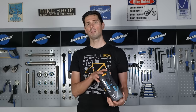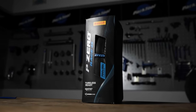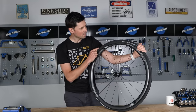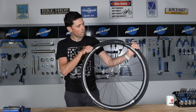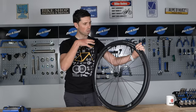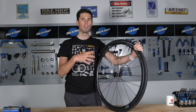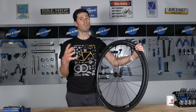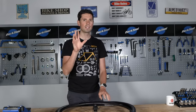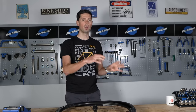The reason some tires are going to be super tight to fit — nine out of ten — is because they're brand new in the box. They haven't been fitted onto a set of wheels and inflated, which is going to help stretch them. Chances are this is the exact point where you're going to run into difficulty, trying to get that last section of tire bead up and over onto the wheel rim. I've heard of tips such as trying to warm up the tire on a radiator, trying to pre-stretch the tire to make it slightly larger, and also using a slightly thinner rim tape. All of which will help a little bit. But I think the most important thing to try is to simply use a small amount of lubricant onto that section of tire bead — it's going to help it slide up and over the wheel rim.